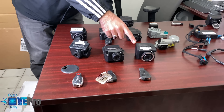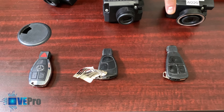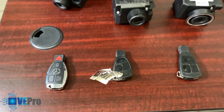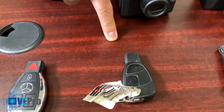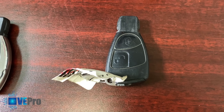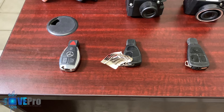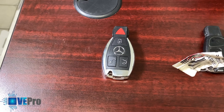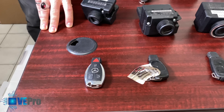You can see the different kinds of keys Mercedes has created over the years. The oldest is the IR key called the fisheye key — shaped like a fisheye — and it has a Motorola processor. The next one is called the neck key. These are serviceable. The latest key is called the chrome style key, the FBS3, and also FBS4. Right now FBS4 keys cannot be generated, only FBS3.